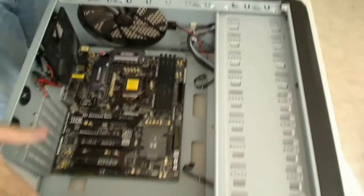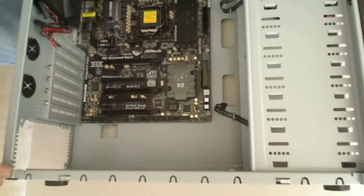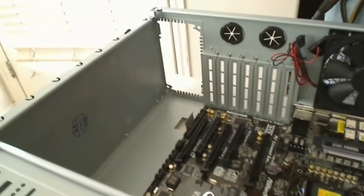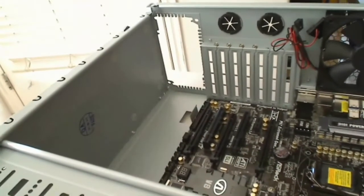When you have a bottom mount case, there are a couple things you want to be aware of. Some cases come with vents on the bottom, but this one does not. So for this particular one, we need to make sure that when we mount the power supply, the fan faces up — we don't want the fan facing down. If it had a grate on the bottom, you'd have the option to mount it fan facing down, but since this doesn't, we mount it fan up so we don't burn up the power supply.